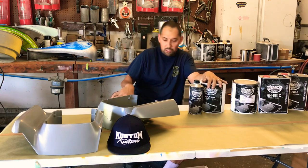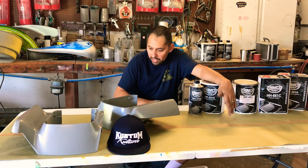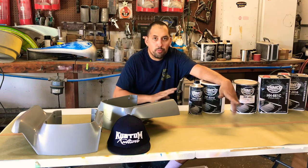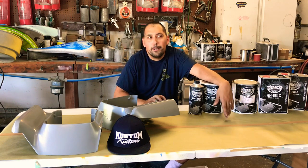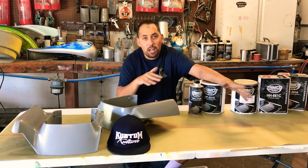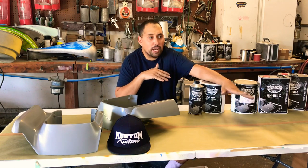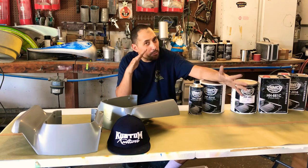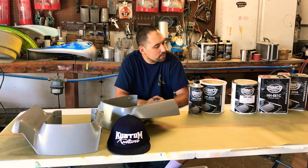You could think of the DTM as like a polyester — a lot of you guys like using polyester stuff. But with polyester, it still has to have a certain amount of resin content and solids. All the Tamco products are based on resin solids. If you're big on sanding and blocking between primer sessions, the DTM is going to give you that high build so you can finalize all the body lines, fill those little areas, and give it that nice touch.